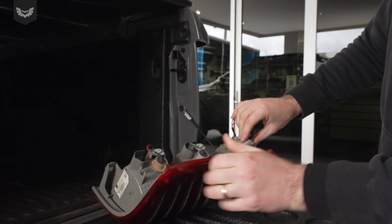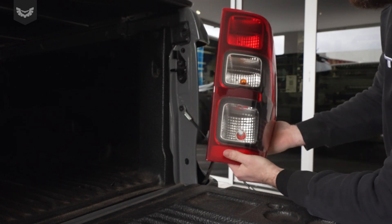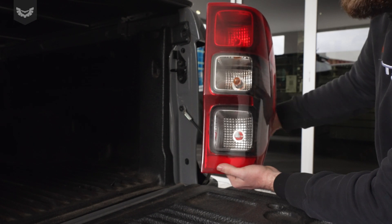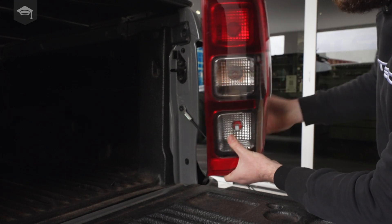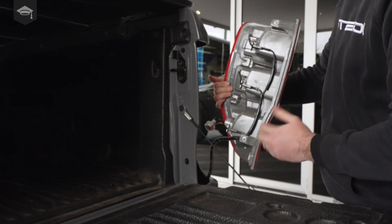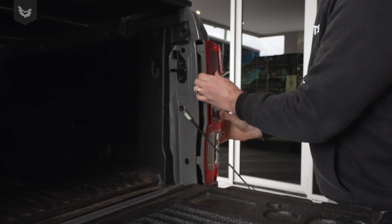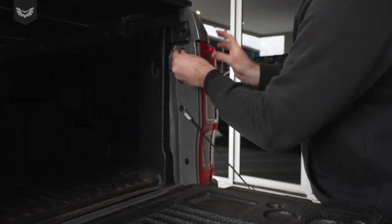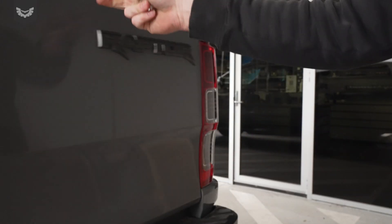The easiest way is to twist it into place, getting that little orange mushroom clip into position. For aesthetic reasons, you can twist the LED so most of the LEDs face left and right. It's now installed — you can cable tie that back if you wish, just make sure it sits in one of the square holes in the back. Line the tail lamp back up, push it into place, reinstall the screws, repeat on the other side, and that's done.